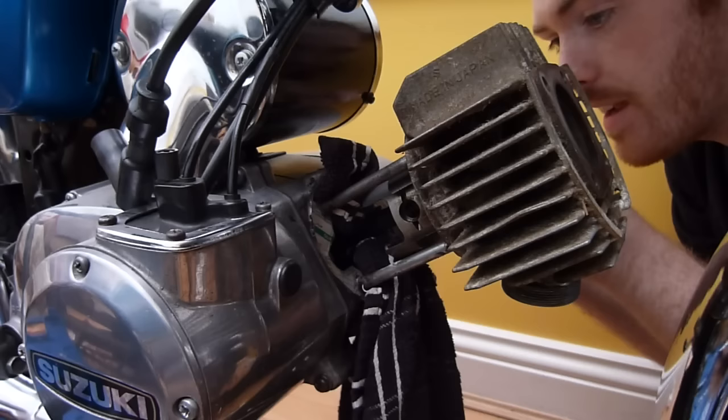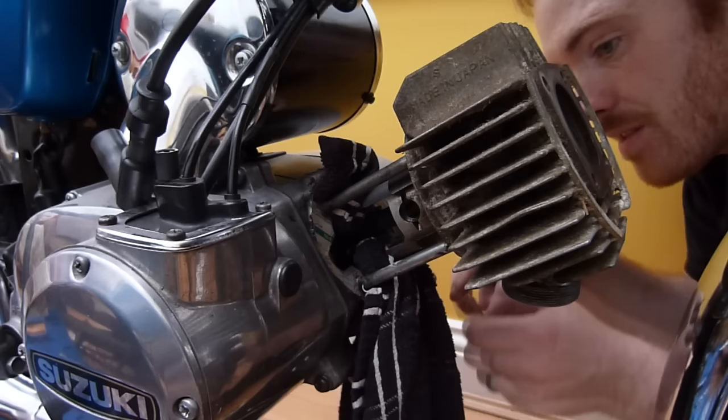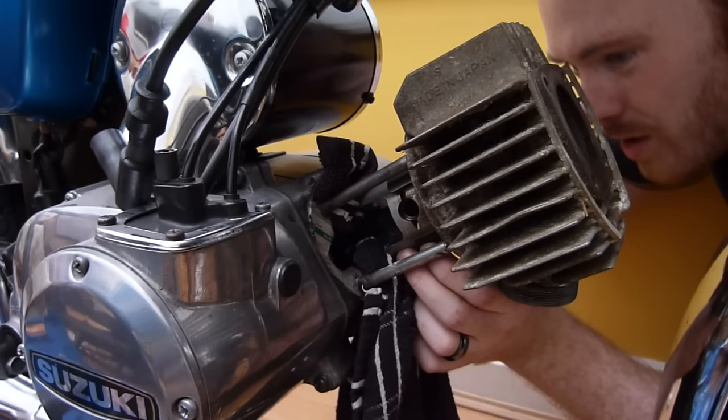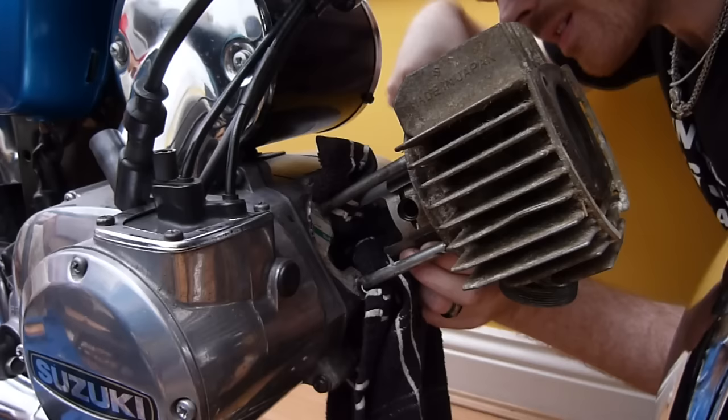Right, so I'm now around this side. I'm going to stick the gudgeon pin in. I've got all my ports nicely covered up, so if anything goes flying, it's not going to drop down in the crankcase, which I bet you many people have done before. I have done before. It's an annoying thing to happen. I've been lucky enough to pick it out with either a magnet or a pair of pliers, but other than that, we should be able to get this in. Should be, is the optimum word there, for just trying to grab the end of a gudgeon pin, twist it and stick it in.